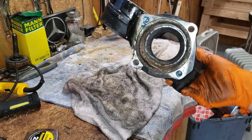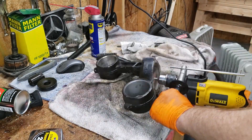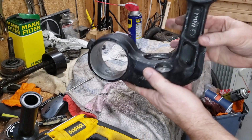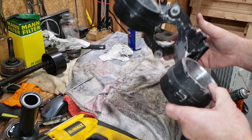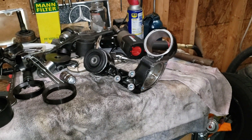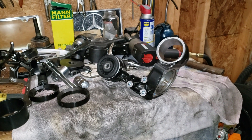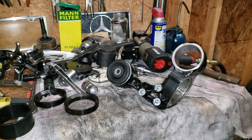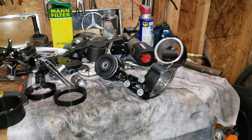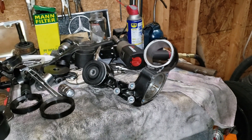We've got our braking support mounting bracket naked. Next up, we're going to clean this thing up and get ready to press in the new parts. We've got our bracket cleaned up — all the bushings out, two bores cleaned up pretty well. I just gave it a good wash with soap and water. So we'll go ahead and get these two new bushings installed and then put a coat of paint on it. In this video you will have seen the removal of the bushing from the lower control arm on the driver's side, plus the removal of the bushings from the braking support mounting bracket. You'll note there's already a new bushing in this side — I went ahead and got that one installed ahead of the game, but you're going to see the installation in part four.